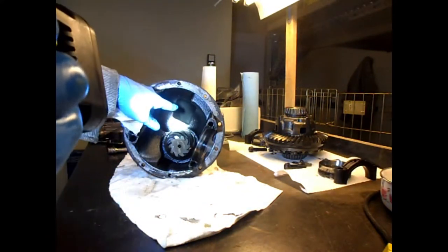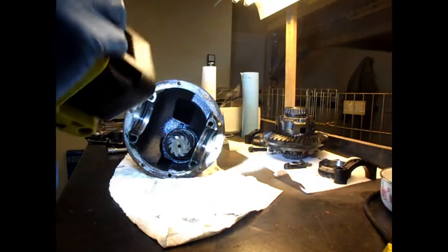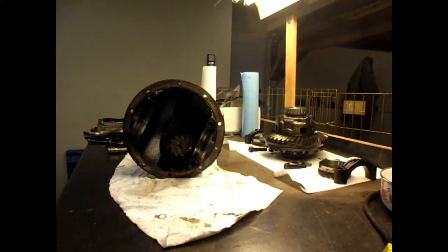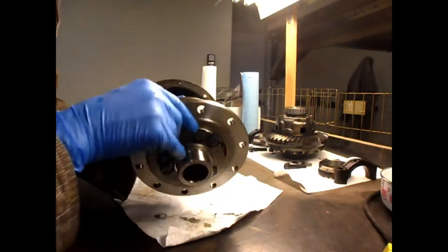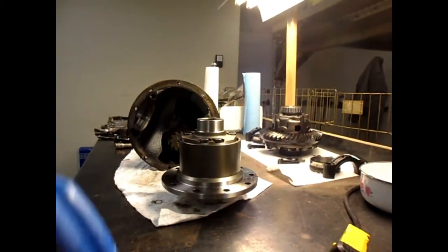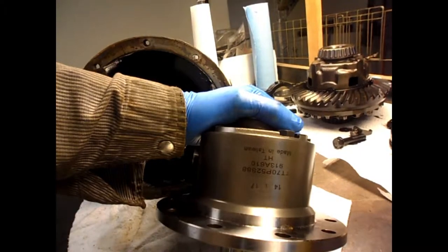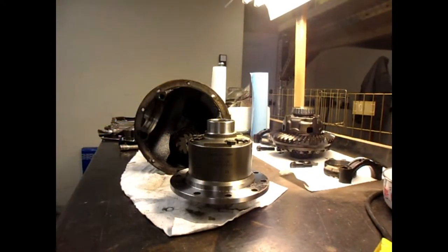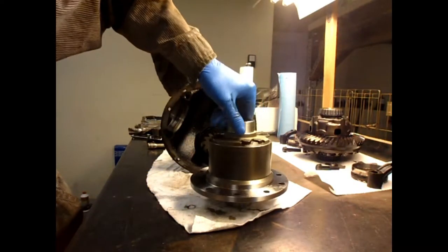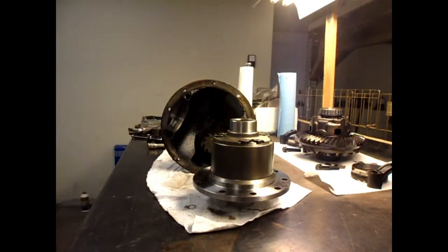It's interesting to see there's an oil passage from the top that comes out the bottom here — I wonder if maybe the missing part is stuck in there somewhere. This TrueTrac is going to replace that. I'll have to press the new bearings on. Unfortunately, what I don't like is what it says here — it says 'Made in Taiwan.' I assumed these would be made in the States or North America somewhere, but I can only hope the quality is there. I'm going to use a crush sleeve eliminator kit and won't use a crush sleeve on the new one.